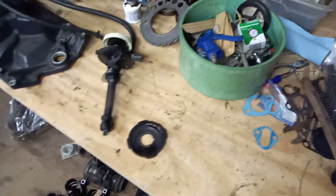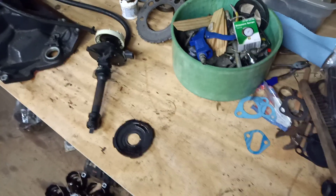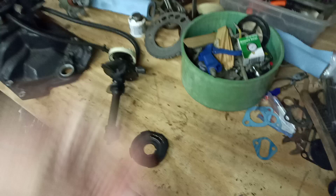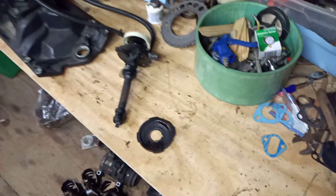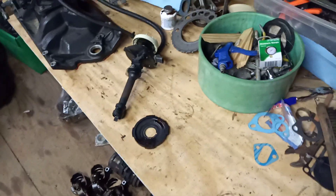So 300 degrees is where the injector stops firing — it's about 60 degrees before the piston is at the top of the exhaust stroke, because it's getting ready to pull that fuel down on the intake stroke. The reason they do it at 300 degrees is they spray fuel on the back of a hot intake valve to help atomize the fuel, which helps the engine idle with cleaner emissions. When I say degrees, I mean 300 degrees of crankshaft rotation, not temperature.